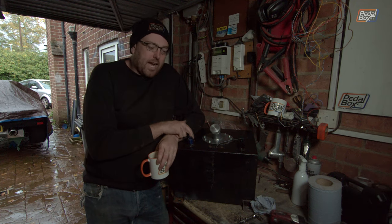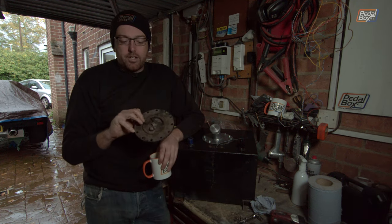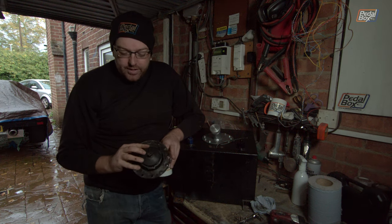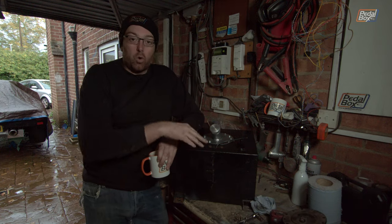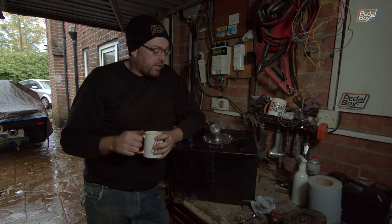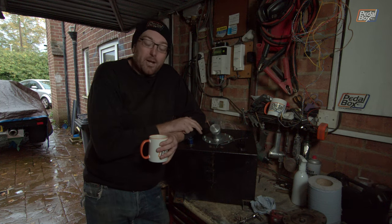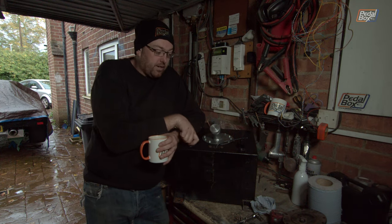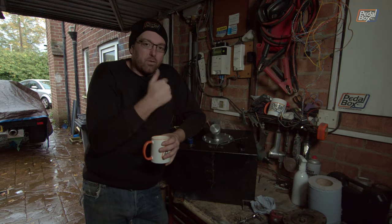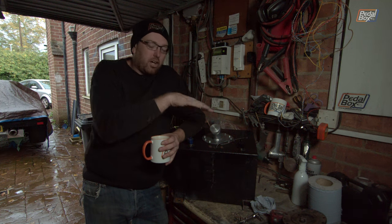There is one more thing we're going to have to add to this. The old lid has integrated venting — if you look on the underside you can just see there are some holes in this little flute, which will be the vent for when this inevitably gets warm, tries to expand, and deals with the vapour inside. At the moment what we've made is a completely pressure sealed container. So we're going to have to get a little vent tube that goes onto an AN fitting, run it down, and hopefully vent to outside of the car rather than underneath the bonnet area.